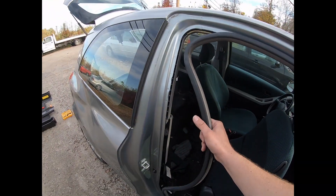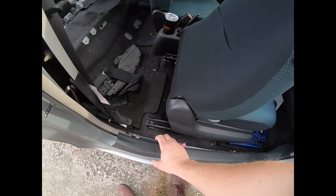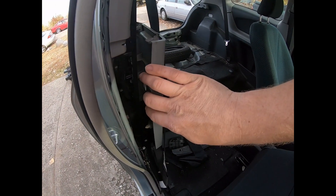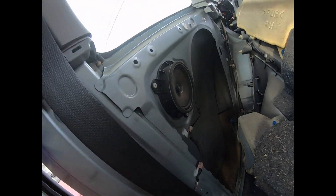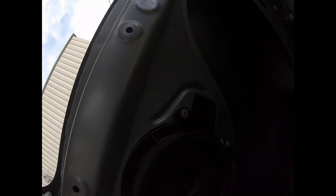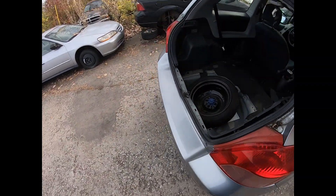What I found easiest was to pull the rubber weather stripping away from the door pillar and then lift up on the little plastic piece — your door seal — and pop that out; it'll pop right back in. Then you're able to get your fingers right in there and work your way and pop everything out so you can easily access your rear speakers. If you are wanting to upgrade them, you will need to drill out the little pop rivets that hold them in — they don't have regular screws — but you can put regular screws back in.